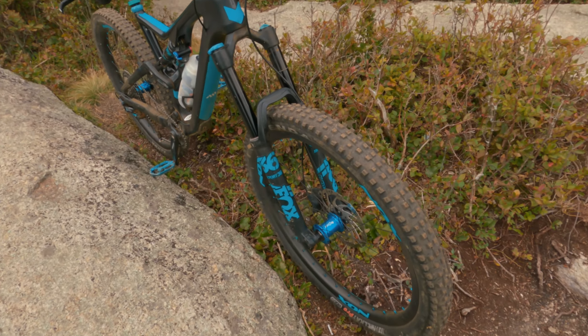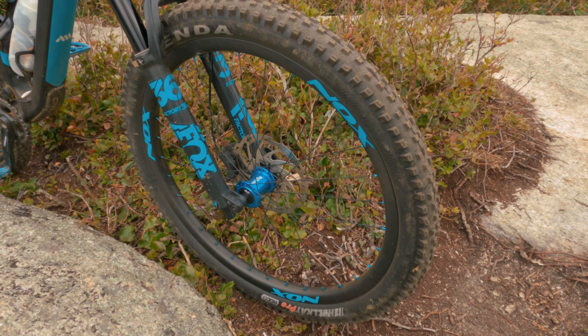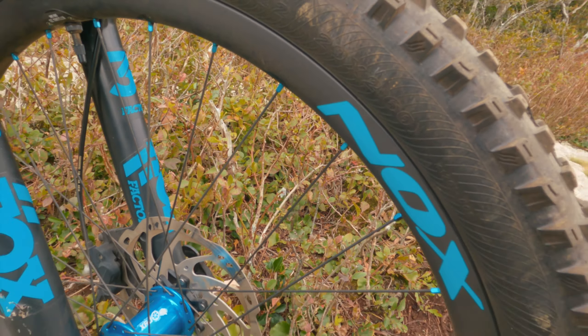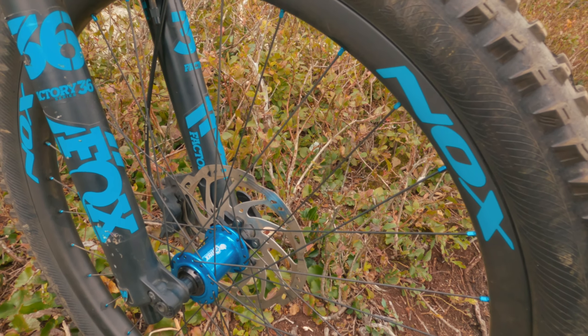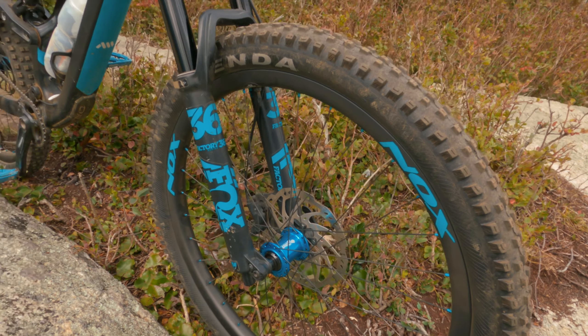On the front I've got Knox wheels out of Knoxville, Tennessee — these are carbon Kitsuma wheels, blinged out with turquoise nipples on the spokes. I've got a 203mm rotor front and rear. These wheels aren't the lightest carbon wheelset, but that's not what I was looking for. The reason I got the Kitsumas is because they are 36 or 37mm internal width, which is huge. I'm a big dude and it's really helped my balance and keeping the bike vertical underneath me on crazy climbs.